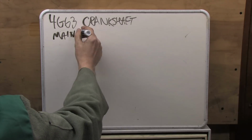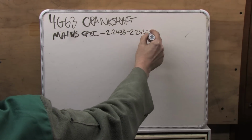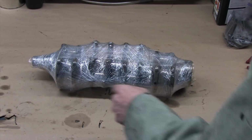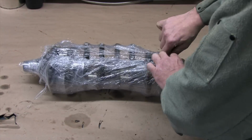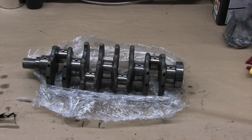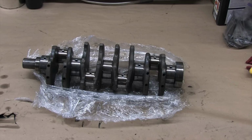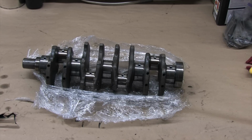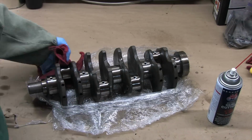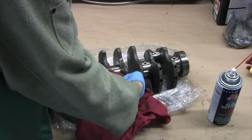You have to do this to make sure the crank isn't junk. If it's been through too much work already, then you might have a hard time getting your bearing sizes right. The crank I'm going to be using is the same crank that was in my crankshaft refurbishing video. It was a stock 6-bolt version crank with 130,000 miles on it. I had it polished and chamfered to improve oil flow. I was lucky to have an extra one available for this project, that's for sure. Big thanks, Domestic Killer. The old one was dicked.